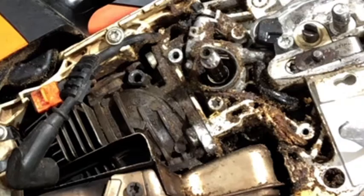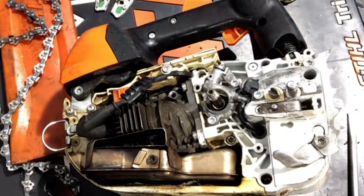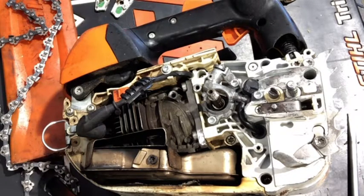This particular saw was actually smoking when it got hot, and that's due to the debris that went underneath the covers. Before I replace any parts, I like to make sure that the machine is clean, so I take it outside and blow it off. Just a lot easier to work with, and everything goes back a lot smoother when you're trying to reinstall it.